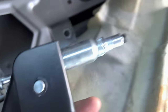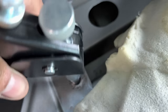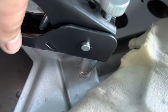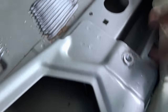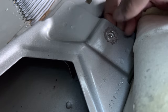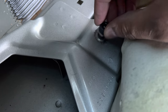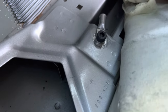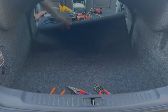I'll stick the nut-cert into the hole, then squeeze it with two hands and it'll crimp that fitting into the metal. I'll be back. I think I got it — see that? Now I've got threads in there. This is an M8 by the way. I'll just take this allen-head bolt and screw it down. You can put any fastener you want in there but now you've got a solid ground. Let me get the wire crimped up on it.